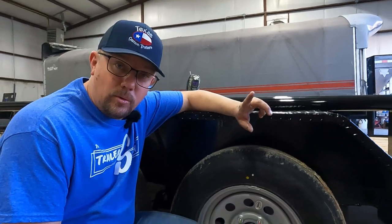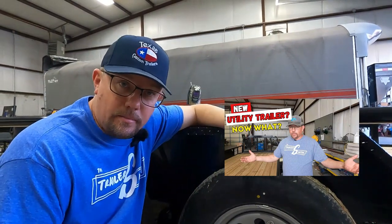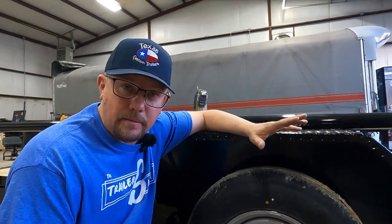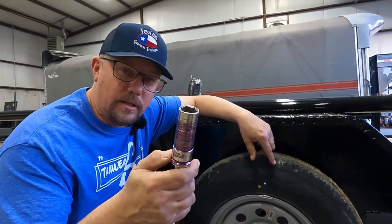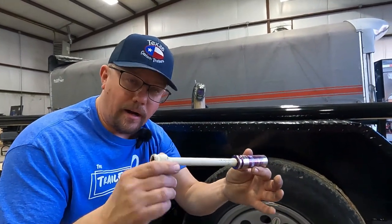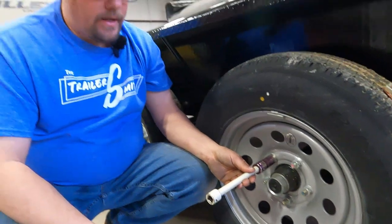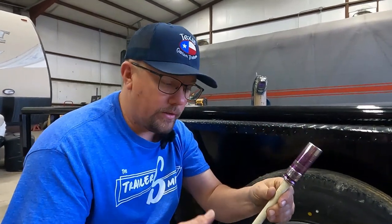When buying a new trailer, if you don't know about tightening your lug nuts, check out the video — we'll leave a link about tightening your lug nuts and making sure your wheels don't come off. Manufacturers recommend that after you purchase a new trailer, you re-torque them at 25, 75, and about 150 miles. Something that helps is a torque stick rated for your lug nut. This goes onto an electric or air impact. When you go to tighten, it will stop — it will not over-tighten the lug nut. It's an easy way to check them. There are several different setups depending on the required torque for your wheel.